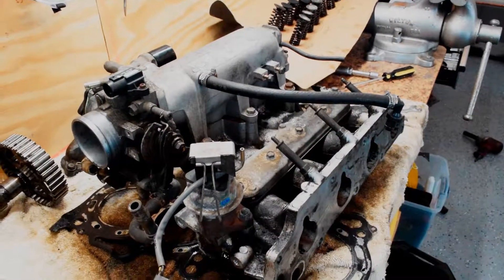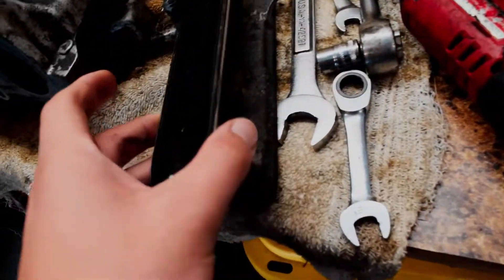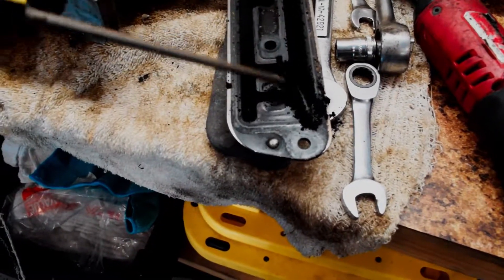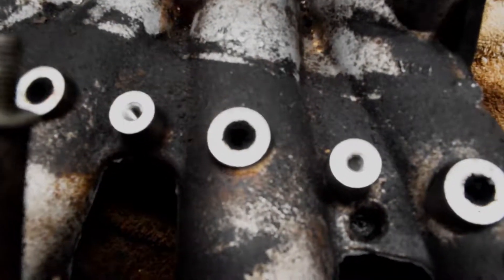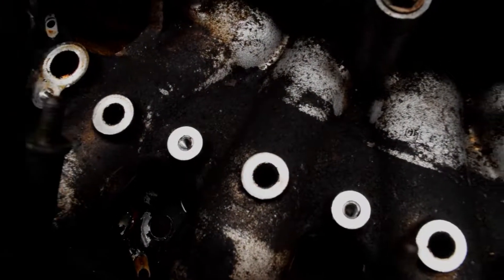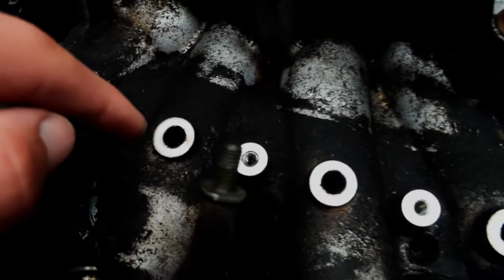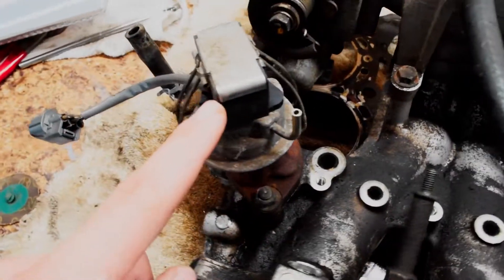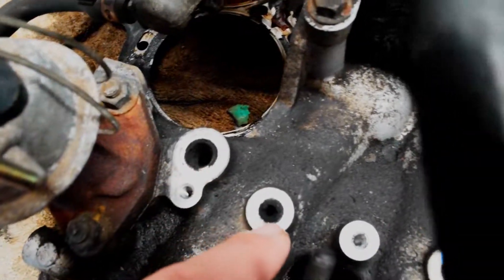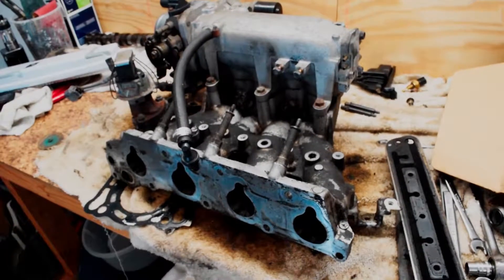I took off all those 10mm bolts and that removed the whole EGR plate. This top plate comes off, and now you can take this piece off — it's full of carbon. The ports in here are what are really full of carbon; I've already cleaned it out a little bit. These guys are almost clogged — if they were fully clogged I might have a check engine light. The EGR valve connects to your exhaust and sends exhaust gas into each cylinder to help keep combustion temperature down.